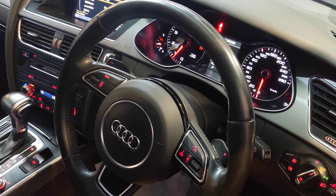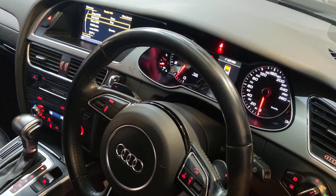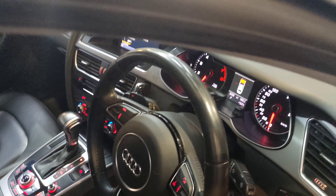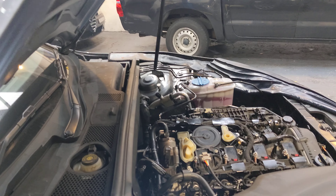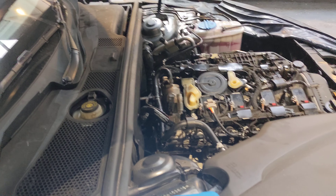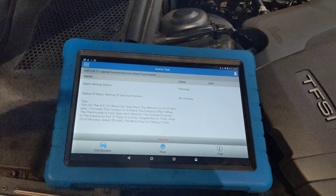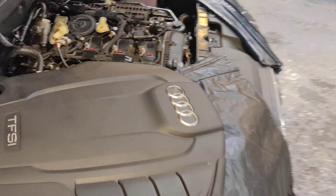This particular car — I finished the coolant reg about two hours ago, filled up the system, left it sitting there, turned the heater on, started the car, and it was just violent stuff going on in the cooling system. We had no choice but to use this function to open the thermostat and circulate the coolant. Maybe in the past I've just been lucky, but I was avoiding it because theoretically you shouldn't really need to do that.